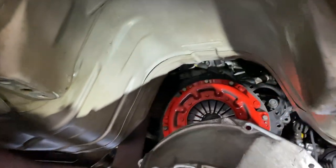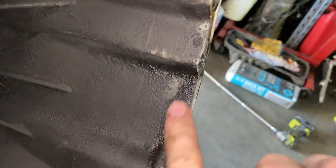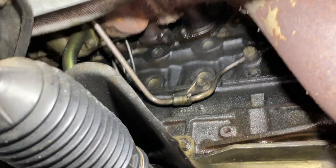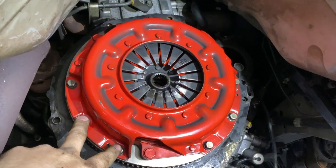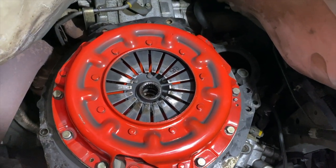Now that it's dropped you can see the back there — the new clutch that was installed last time, still all nice and greased and lubricated. This car's engine is very smoky and breathes a lot, so it's actually leaking oil — not from the rear main, it's actually from up the top end, pumping out the rocker covers. So if you're going to be doing just a clutch or a gearbox in your car, check your clutch — put your nine bolts around, take that off, take your clutch plate off, and have a look at your flywheel.